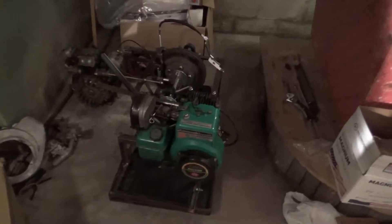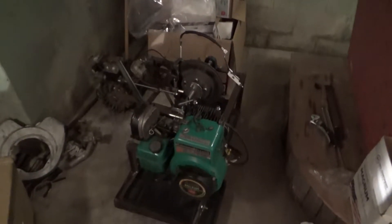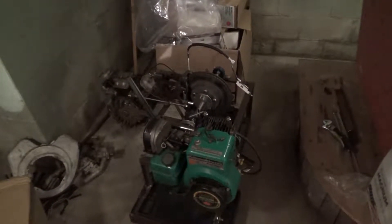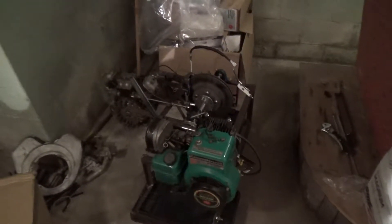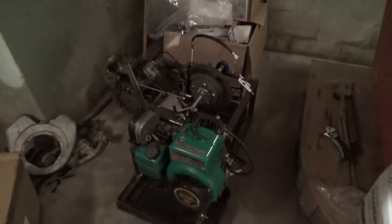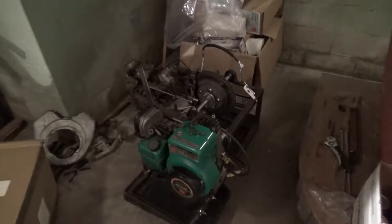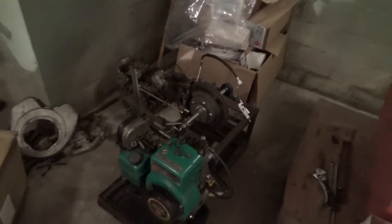Things I learned from that: I need finer control over the brakes. I'm seriously thinking about picking up a MAC valve — like a four-port MAC valve — for air pressure control into the brake caliper. For a while I thought I'd need hydraulic control, but air is more than enough for a small engine. I may need to go to something different for larger engines, but for right now air is plenty. And if I need to go hydraulic I can add to this dyno at a future date.